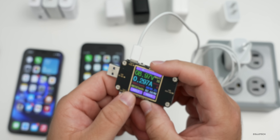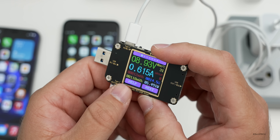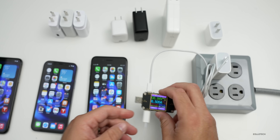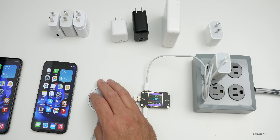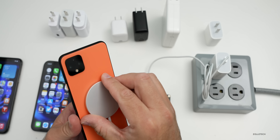The iPhone 8 Plus is at eight percent charge and we're already at about five watts of charging, so you definitely can charge an iPhone 8 Plus with it but we're not getting very fast speeds. I did hit six watts there for a second, but don't expect fast speeds with this charger on anything but the iPhone 12. Apple does say it can hit seven and a half and we're bouncing between five and seven watts.